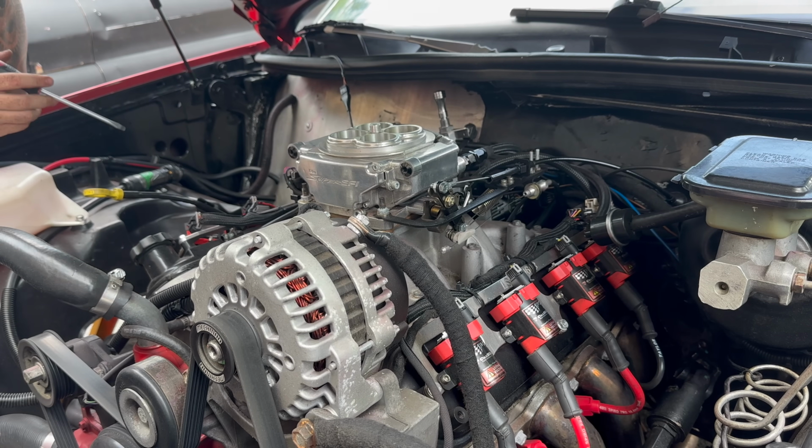Yeah, I mean, you could unplug injectors. Or, I'm sorry, coil packs, and see which one... But it's not misfiring at idle. That's the problem. If it was misfiring at idle, you could do that and see what's going on, swap coil packs and stuff like that. Yeah, I could just take one off, see if it makes a difference. See if it got worse. I don't know.